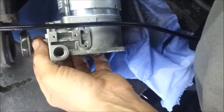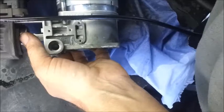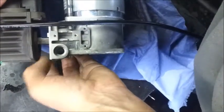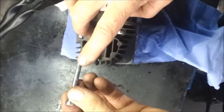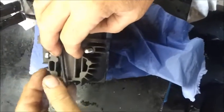So you locate the mounting bolt spigot and then make sure that the piston seal locates in the bore correctly, and then slide the piston cylinder onto the piston head. It's now time to refit the cylinder head bolts. It's a good idea to put a little bit of Loctite on this bolt for added security.